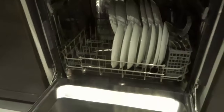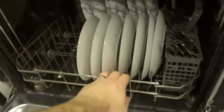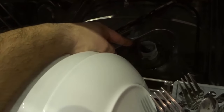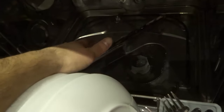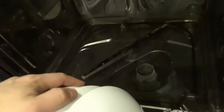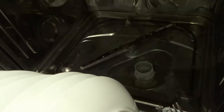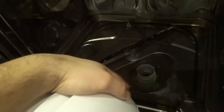Then if that doesn't work, the second step is going to be to check your drain filter. If you open up your dishwasher and look at the bottom, you're going to likely find a drain filter. As you can see here, that is my drain filter. See if you notice any debris, dirt, or food in there. It's really easy to clean — I've done a separate video on it, so you can look that up on how to clean a drain trap in a dishwasher.